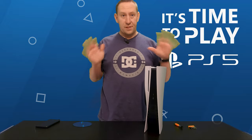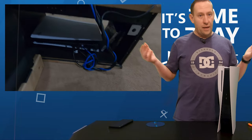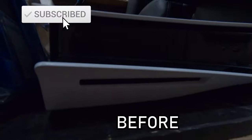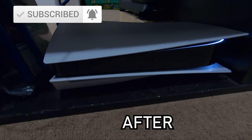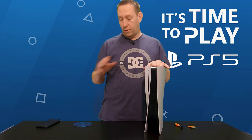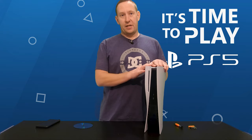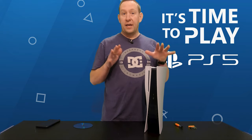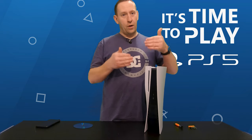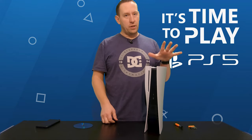And that's it — this has been fixed. Now go to your PlayStation, connect your cables, plug it all back in and load your game. It should be noticeably quieter. The drive is still loud to start with, but it shouldn't be as loud as it was before. Mine sounded like it was trying to eat my disc, which was concerning — I definitely needed to do this fix. Give it a try and see if it fixes yours. It shouldn't break anything. Really all you're doing is engaging the eject mechanism and trying to make it get caught at a different point, because I think Sony realized that some of them were just adjusted a little bit too tight.